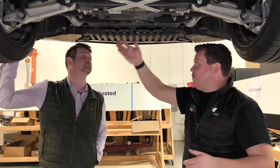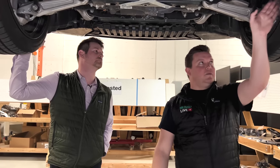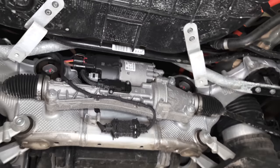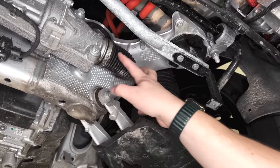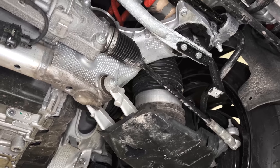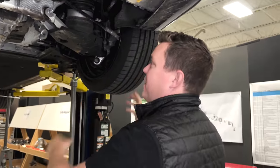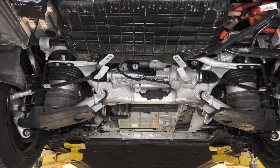One other core aspect of this vehicle — it is front and rear steer. There's a full front steering rack, and by front steer I mean it's articulating from the front of the pivot. In the back of the vehicle they're actually steering the rear wheels with a much smaller steering rack. Instead of a fixed link there's a smaller range of motion — the bellows are not as big as you'd need to steer the front wheels. Turning the rear wheels a little bit in the opposite direction while cornering is a huge advantage — not intended for crab walking, but very useful for high-speed and medium-speed cornering. I'm excited to drive this vehicle.